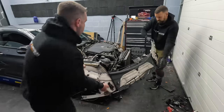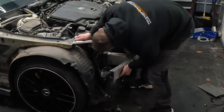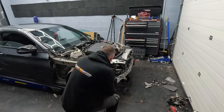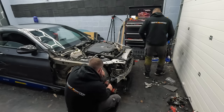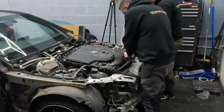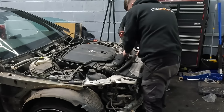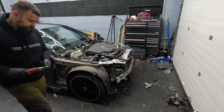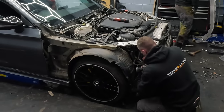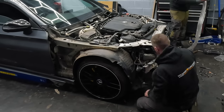Next we're going to fit the crash bar, starting by lining up the crash bar with the mounting points and chassis legs. We'll give it a gentle tap with the hammer until the bolt holes line up and we can tighten it all in. While we're at the front of the car, I'm going to put the air intake pipe on just to get it off the floor. The air intake pipe takes cold air from the front of the car and forces it into the air box and then feeds it into the engine. There are also various clips and plugs to connect up — like attaching the horns.